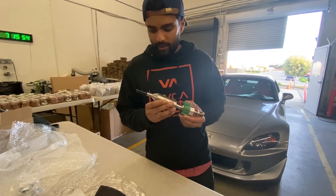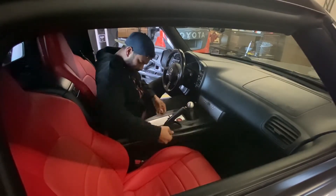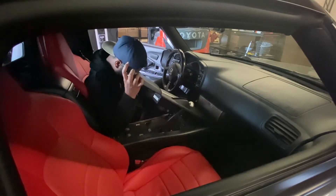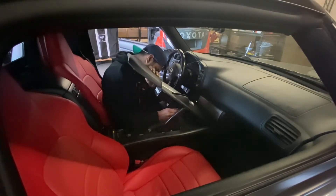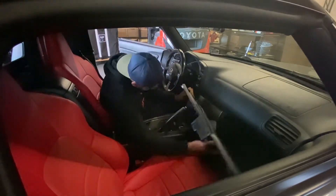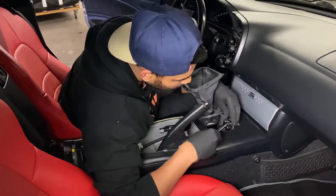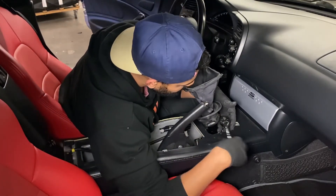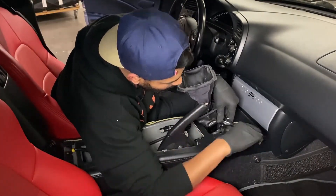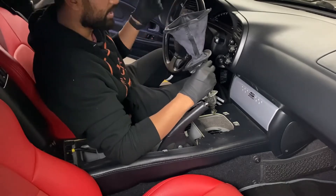If you've never done this before, don't sweat it — it's super easy. The first thing you're going to do is pull the e-brake up and out of the way. Second thing you're going to do is start to pop off the center console. Once you do that you'll have access to the two plugs that you'll have to disconnect. It turns out the previous owner had used Loctite on my shift knob so I wasn't able to remove it during this process. Once you unplug the two plugs you'll have access to the rubber shift boot and also the plastic ring — be very careful removing the plastic ring as you will be reusing it. Then once you remove that you'll have access to the hardware that keeps the OEM shifter in place, and once you remove that the OEM shifter will pop out and you can begin the process of installing the Renegade short shifter.